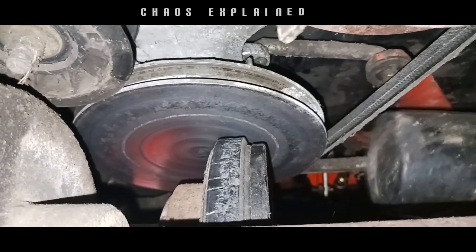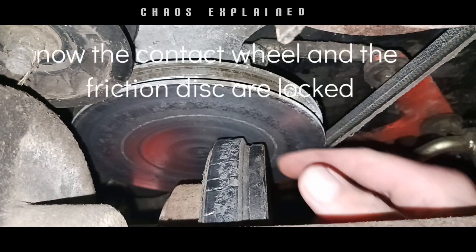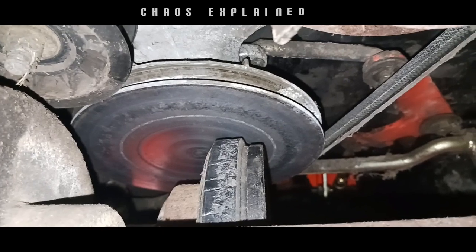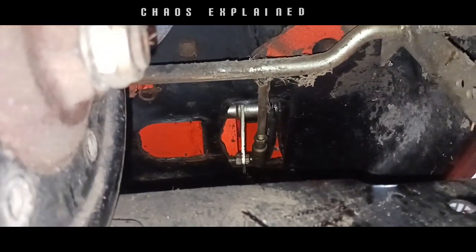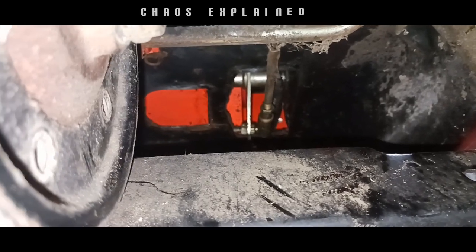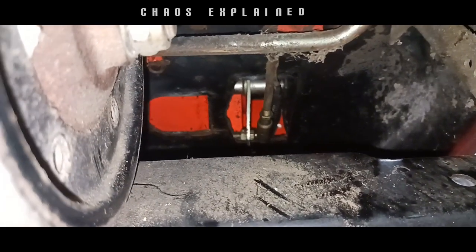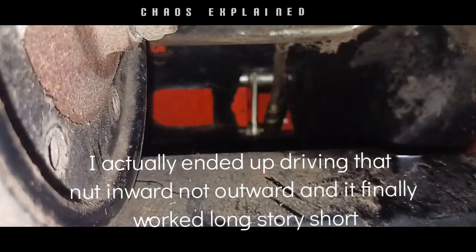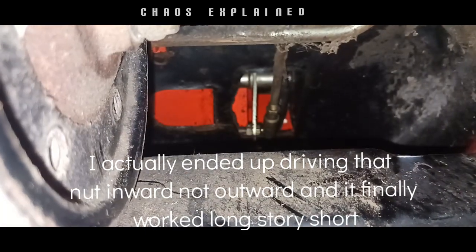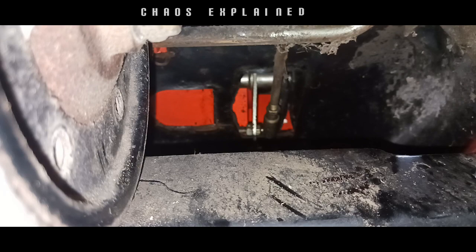If I come over here and just tap it, that little jar right there knocked it that way and forced it, so now this wheel can't turn. Now if you look up in here — this design applies to snow blowers too, Ariens makes more snow blowers than anything — there is an adjustment right back up in there. I'm going to try to adjust that rod out, because I'm basically bottoming out on the lever. Over time these parts bump into each other, wear down, and it's not making it engage, so I'm going to adjust that and go from there.